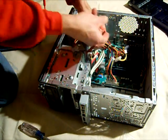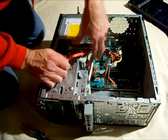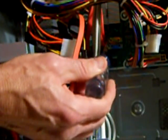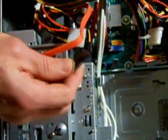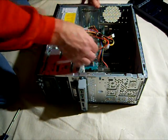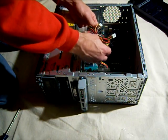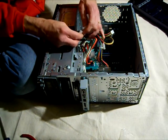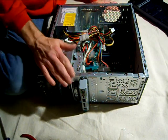Now I'm going to take my SATA cable. Down on the board there are two SATA cables already plugged in, and then there's also SATA 3 and SATA 4. I'm going to go ahead and plug this into SATA 3. I need to plug this into a power source too — let's find one that's not being used. Got all that in. Now it should be all set up.